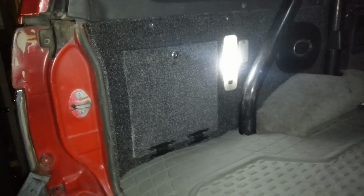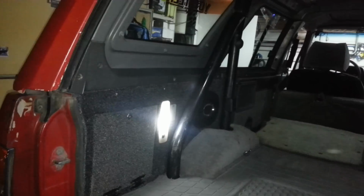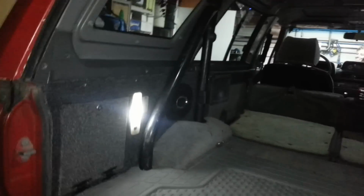I really don't understand, but anyway, these both lock. They're both hinged and very tight. To make no rattling, I've actually bent the tang, the tongue on the back of the lock, to secure it tightly without damaging the lock over time. So it turns smoothly, but it still is very secure.